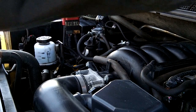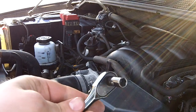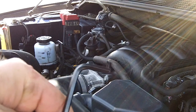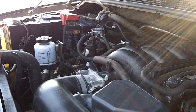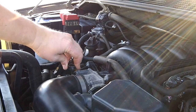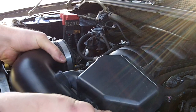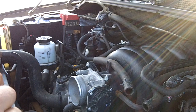I've already gone ahead and pulled the hoses off the air tube. You'll need a socket wrench — just a little guy — an 8 millimeter and 10 millimeter sockets, and a 5 millimeter hex. Starting off, use the 8 millimeter socket. The clamps on the air tube are already fairly loose — just loosen them off, then go ahead and pull the air tube off.